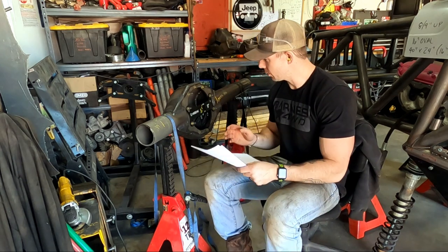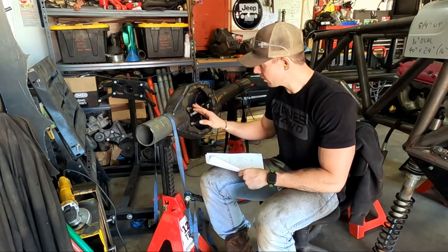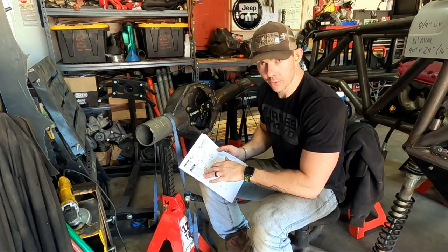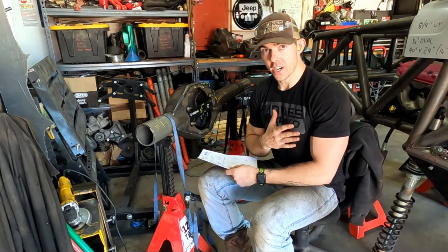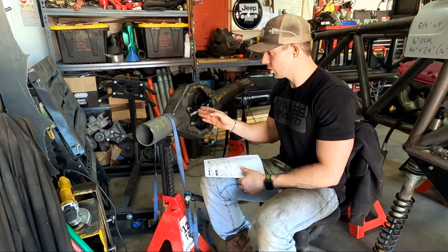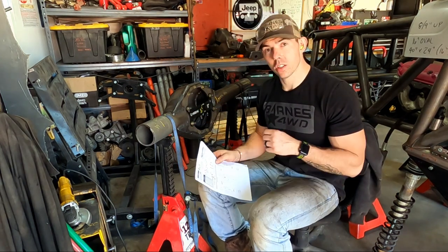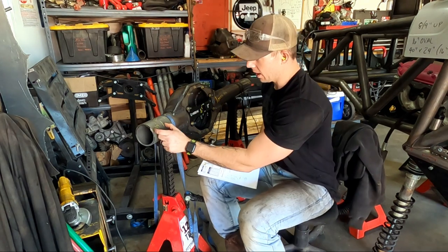I went ahead and put a centering piece in to get good measurements from the actual housing, using the configuration sheet found on Spider Tracks. My original goal was to have a nine-and-three-quarters-inch offset — the center pinion nine and three quarters over — but in the chassis it was a little too far over. So I shortened it up to move it more toward center. From the center to the pinion it's going to be eight and a half inches — an inch and a quarter difference from what I originally planned, so everything shifted over just a little bit on the housing.